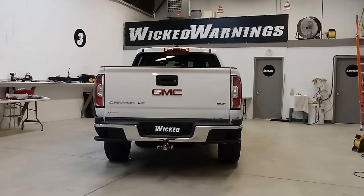Out back of this truck, as I mentioned earlier, we've got our HAW DUOs in high dome, side mounted in the reverse lenses and taking the place of the OEM cargo light up top. We've also got the steady burn for both sets tied into the OEM cargo light switch. With GMs, you can do that — I haven't had any problems so far activating the steady burn cargo light circuit.